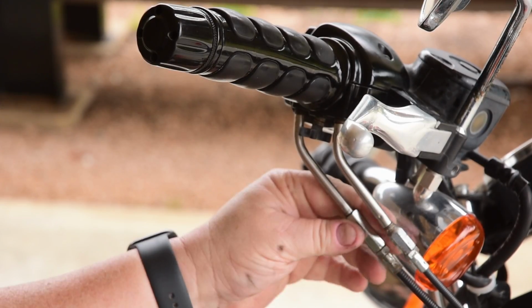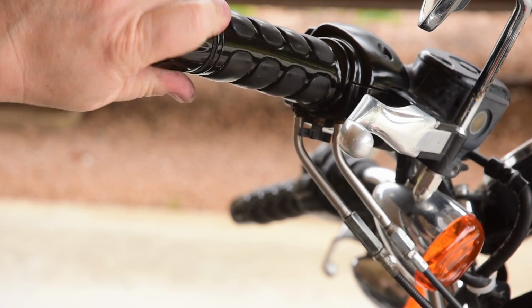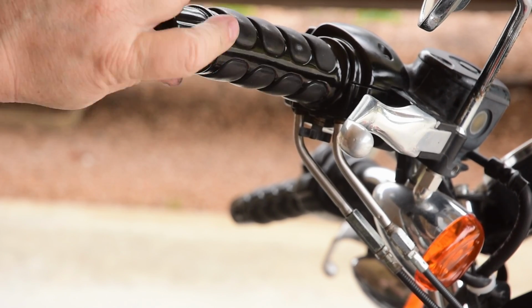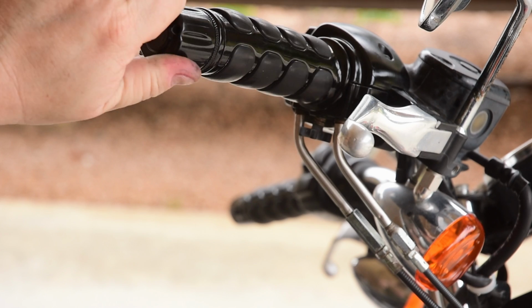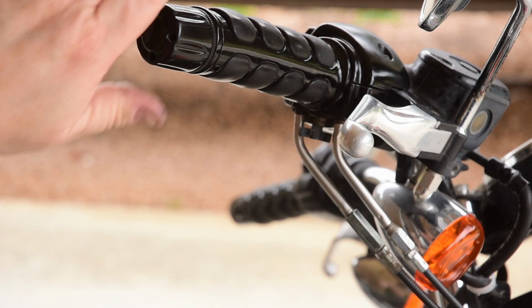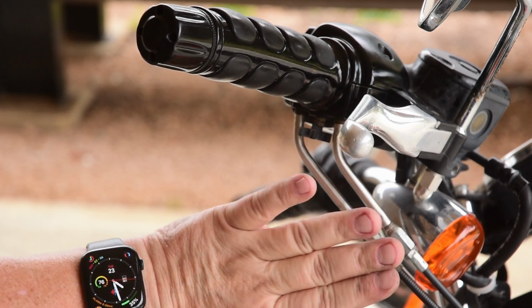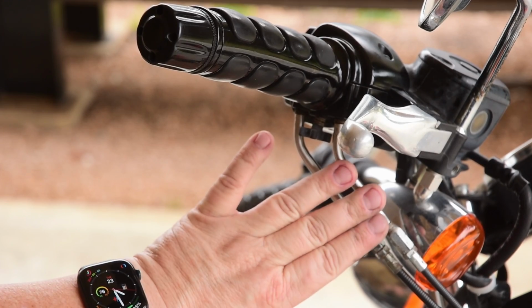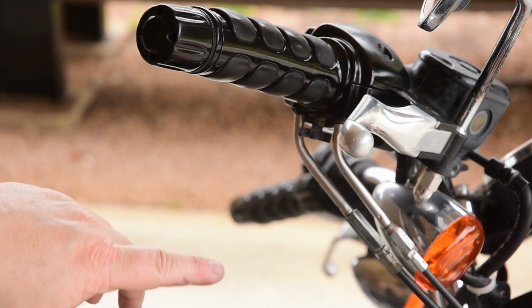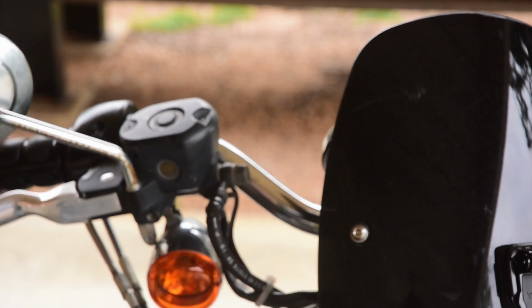Then it's a matter of simply adjusting this knob until you have just a little bit of slack in your throttle. You don't want to make it 100% tight, but you also don't want an eighth of a turn of slop. Just a little bit so that you know your throttle is fully released. I'm going to hold off on that now because I'm about to take the carburetor apart to do the next video in the series, which is all about suck bang blow, and I'm going to be cleaning and changing jets. So let's move on to the clutch cable.